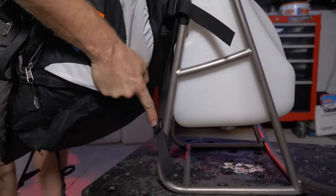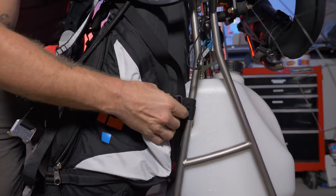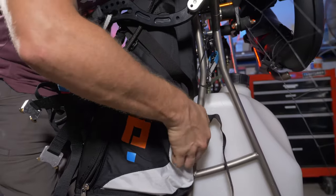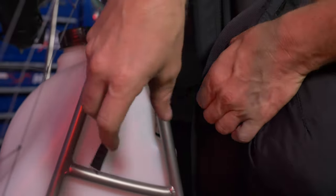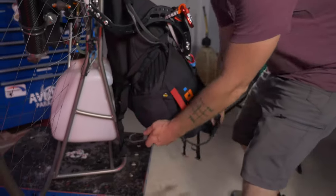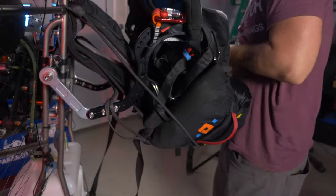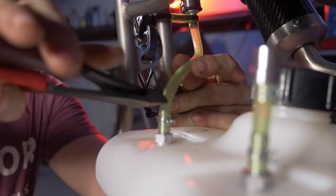Unattach this lower strap — your ground handling strap you can leave in place. This lower harness strap is all you need to loosen up. I'd recommend taking pictures along the way as you're taking things apart so you can reference them to put it back together. We'll do the other side, then grab your bungee — we want to get the harness out of the way so we have access to the fuel tank. Hook the bungee up here, go under the harness and on the upper spar. Then cut your fuel line right on top of the old barb.